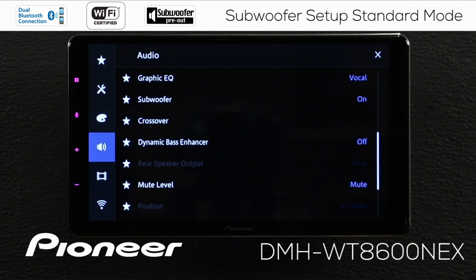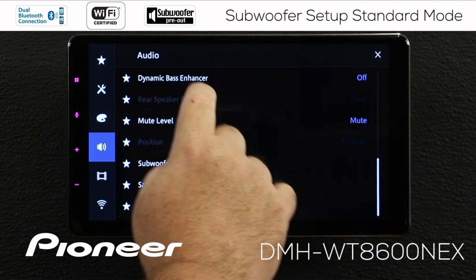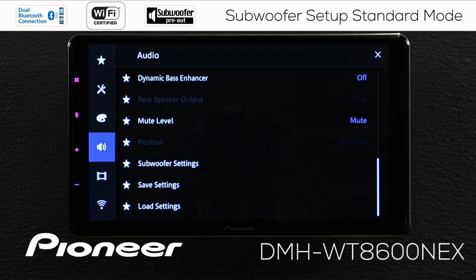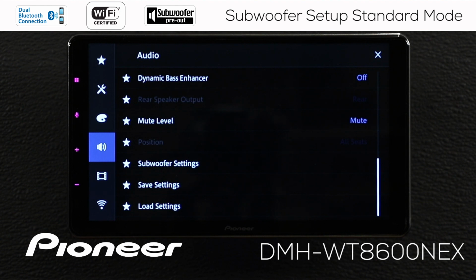Let's go back up. And one more setting we want to take a look at here is the rear speaker output. You can see right now, rear speaker output is grayed out. What this means is the Pioneer NEX receivers are very capable of operating a small subwoofer on the speaker level output. So we need to set that up as subwoofer if we want to run a small subwoofer from the speaker level outputs. But you can see that's grayed out. How do we get there?